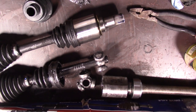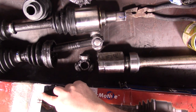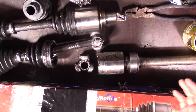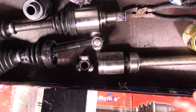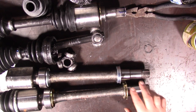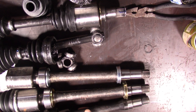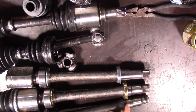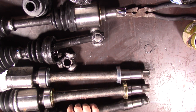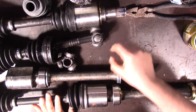So before I measure that, check this out — this crusty box here that looks like it's been sitting around for a while. April 23rd, 2018. This is an axle I got the first time I tried to get this Track Motive stuff to work. I was super happy with the construction of the Track Motive stuff, I just couldn't find something that worked. So as you can see, this is the one that was originally recommended, but this one here is shorter. If we look at this — this is the one that I use — you can see the seal rides right here, this actually ends up being further out. This is actually the correct dimension. Hopefully the joint inside of here is going to be the same size.